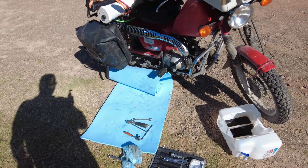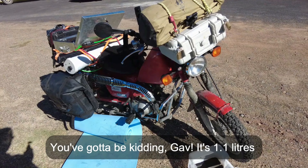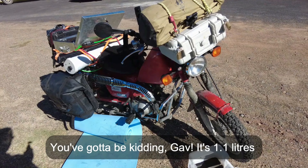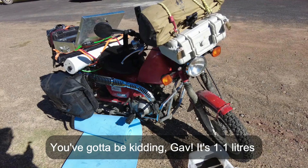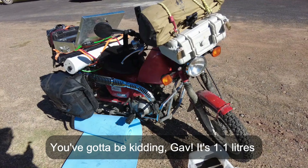I've recovered the pieces of the dipstick — I dropped one somewhere but not inside the crankcase. I'm still going to utilize the cap portion just to keep a lid on it. Now it's just a matter of topping up the oil — about 350 mils goes in. It's all back together again, foot pegs back on. Thank god for this bed roll — it's been a lifesaver kneeling on the hard ground working. It's a keeper, I'll tell you that much.